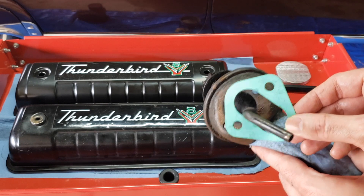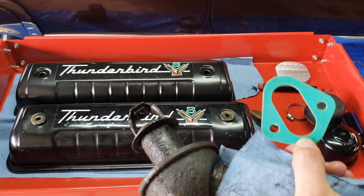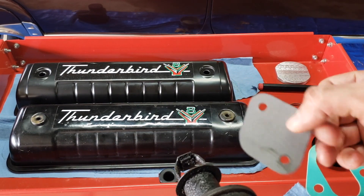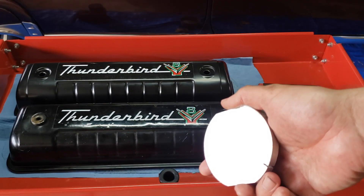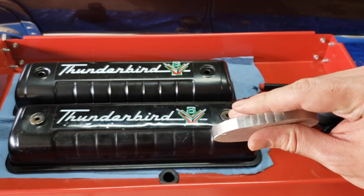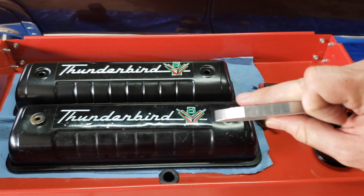So if you end up making your own gasket, just kind of copy the top half of it, then turn it over and do the bottom — kind of like this. I just use a paper hole punch and try to get the holes good on it. This was the piece I made the adapter plate on the car from — just a piece of stock sitting around. This is aluminum, and I made it extra thick when I machined it just to make sure the flatness was good, because if it's not you're going to end up with a leak out the back side.